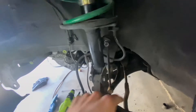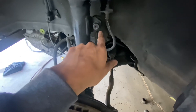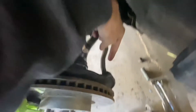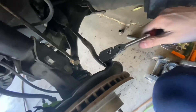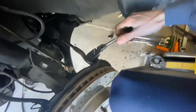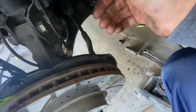When you're putting in your sway bar end link, make sure the other side is also jacked up, otherwise you're going to have trouble putting on your sway link. Go ahead and tighten down your nuts — 17mm, 17mm, and 19mm right at the ball joint. For the sway link nut, don't be afraid to tighten it down nice and good. Same thing with the tie rod — nice and snug tight. These are suspension bolts so get them nice and tight.